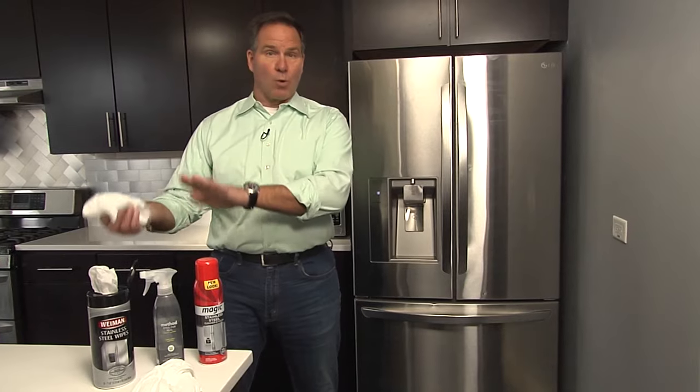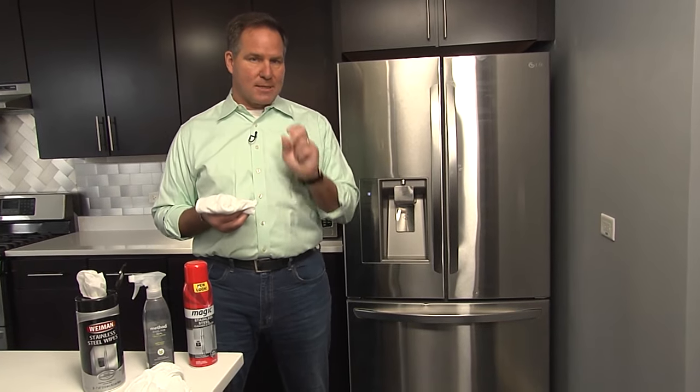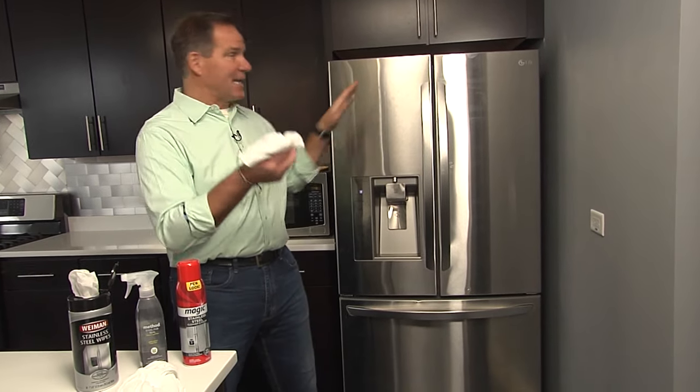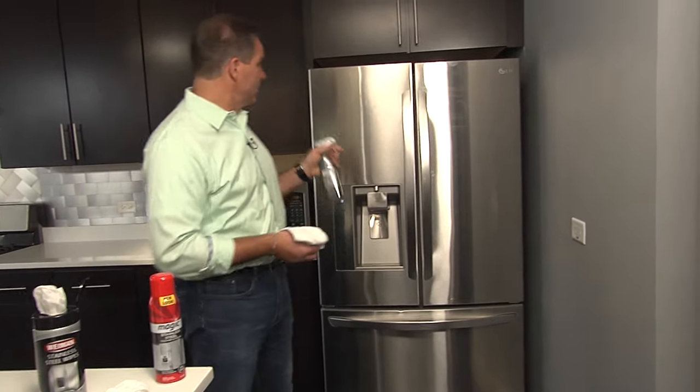Now these are the tricks you need to know. There's a graining in stainless steel. Whenever you're cleaning it, no matter what cleaner you're using, you want to wipe with the grain because the risk is you could put little micro scratches in the stainless, and then when you step back and the light hits it, you'll see it and it'll drive you crazy. The other trick is to take that cleaner, spray it on, and then give it a few seconds to start to get into the oils that are on those fingerprints, whatever the markings may be on the stainless.